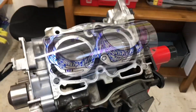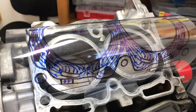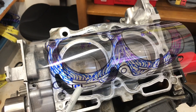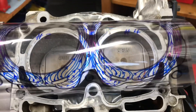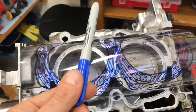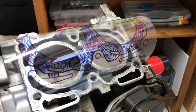This gives you a 3D representation of how that flow field might be occurring inside those heads. At the inlet port you have the highest pressures coming out of those two slots into the head, and from there fluid creates preferential flow paths. Remember, the flow field shown here is for a completely symmetrical system with equal pressure at all four slots — that's not the case in reality. In reality, there will be really strong flow paths going from the high pressure inlet point straight toward the low pressure outlet.